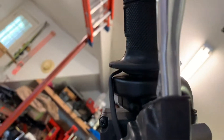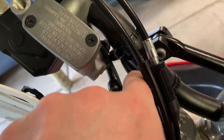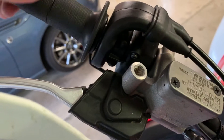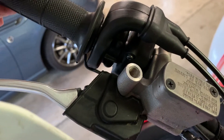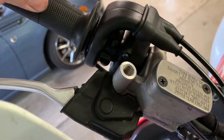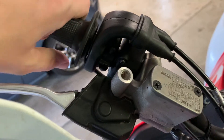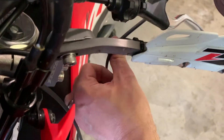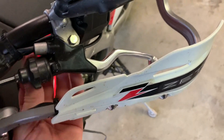I've put kind of a little bit of a bend in that one — it's a little tough to see. I think if I route up underneath here and maybe put it underneath this guy, I'll be good. Just when you're tying that down, make sure you're clear. The last thing you want is for that to be rubbing on there — it's too tight there. When I zip tie it down, I'm going to have extra wire pushed so it's forced to have enough slack to travel around that. Same thing on this side. Take your time, get the wire routing such that it's out of the way and not interfering with any of the controls.